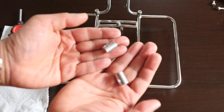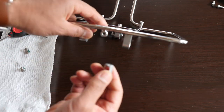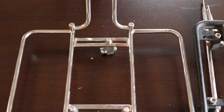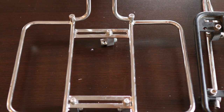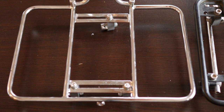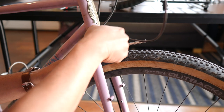I found that the easiest way to set the rack was to mount the central daruma on the rear of the rack and then mount the two darumas on the front of the rack — having those pre-installed so once you have the rack on the bike you don't have to juggle all those screws holding it together. The darumas are on a rail so there is some adjustability in moving them inwards, but I think for most purposes you're going to have them in the outermost setting. With the darumas installed, the next step was to attach the rod that goes on the crown of the fork.